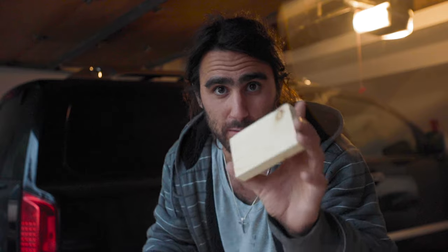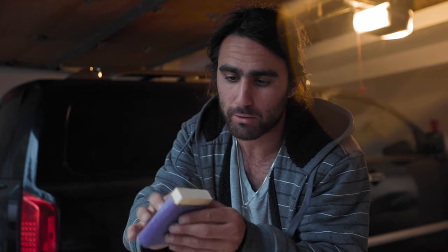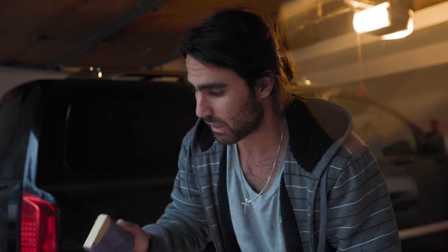Starting with 80-grit paper — just a little tip: I got some scrap wood here, rip my sheets into thirds, then kind of wrap it around to make almost like a little eraser. And then you can just use that to get it down. It has been pouring all day long. I'm going to rip it with some 80-grit first, which is really coarse to get the big chunks down, and then go back with like a 150 or so, which is a little more fine to get a nice smooth finish. That should take care of what I needed for sizing.